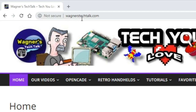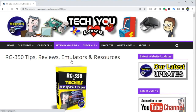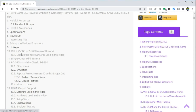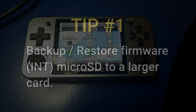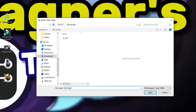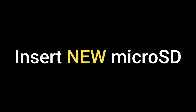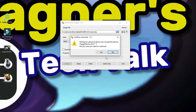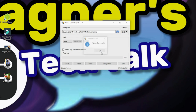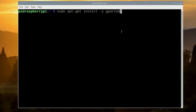If you find the following tips interesting and want to know more, go to wagnerstechtalk.com, then move down to Retro Handhelds and click on RG350 Tips. For our first tip, I want to back up my firmware microSD before applying the HDMI update. To do that, we'll load up Win32 Disk Imager, give the image file a name — I'll type in RG350M_firmware.img — click Open, and then read the image from the microSD. Once read, click OK, then insert a new microSD card — in my case, a 128 GB card — and simply write the image back to that microSD card. Once done, click OK and we are done with Win32 Disk Imager.